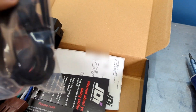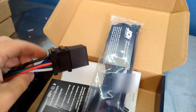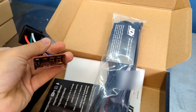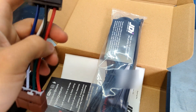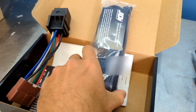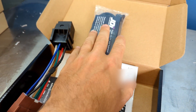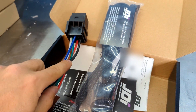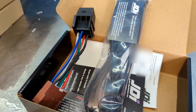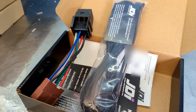So I reached out to JDI Industries, and they have a replacement relay system that plugs right into your OEM harness and then has this relay on it. They also give you this optional tie-in, which allows you to basically disconnect the ground going to the relay for security purposes. So if you want to prevent your car from being stolen, you could use that.